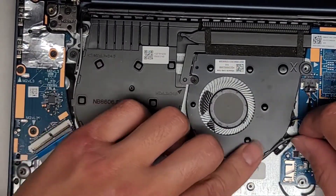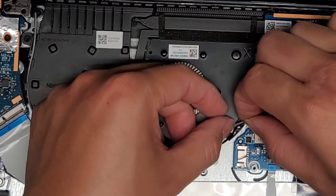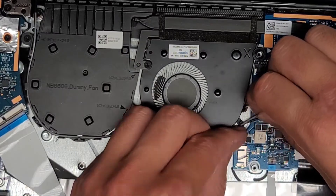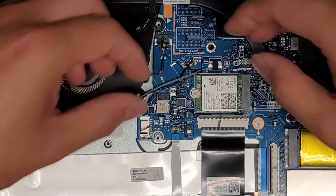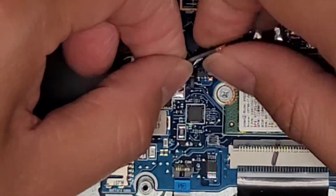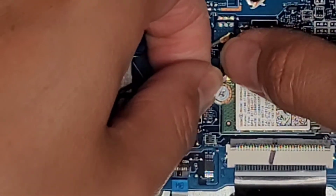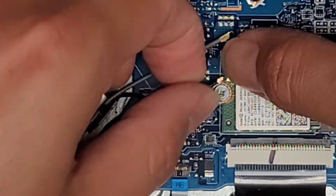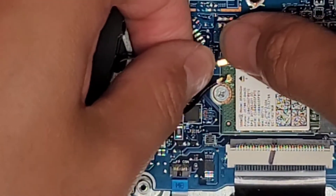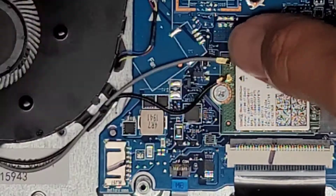Route it through this way. There we go — we just got to get these wires reconnected. The black one goes to the black arrow and the gray one goes to the white arrow. The way you know it's lined up is once it's in the right place you can't really move it around, then you can click it down. Same thing with the other one — click it down. There we go.